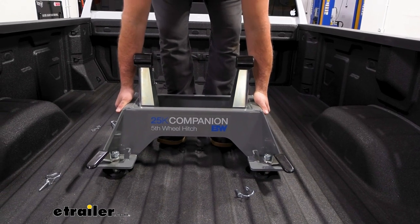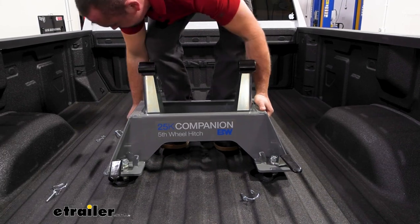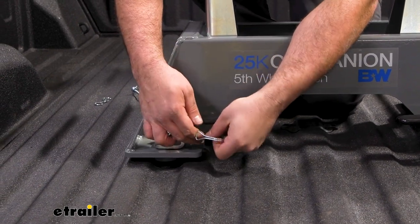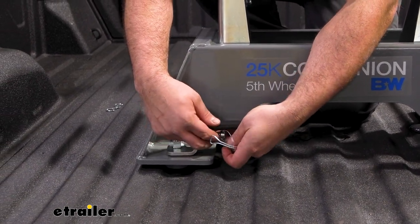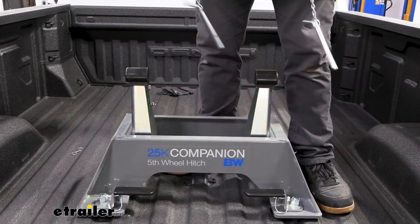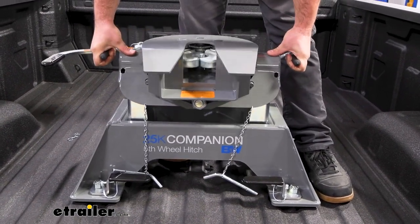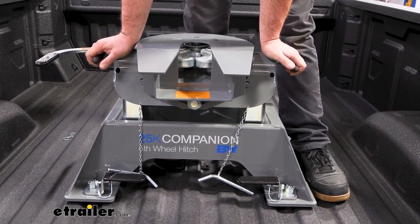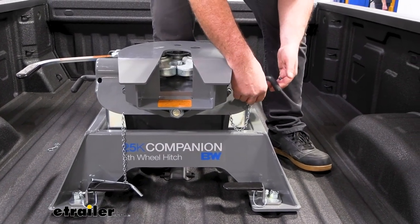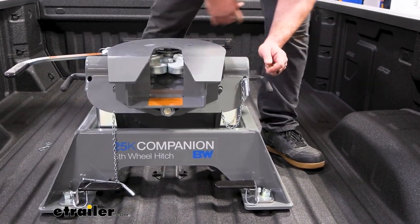You can see pretty quickly how easy it is to drop in — you just center this up and get these lined up with your factory puck system. We'll replace these linchpins, but you can actually run a lock through here if you want to make sure that no one's walking away with your fifth wheel. With the base in place, we'll just drop the head in — the handles you hold keep it open, and once it's in place you let it down. Once these pins are in, it becomes a safety mechanism so it can't become unlatched, because it blocks the handle.